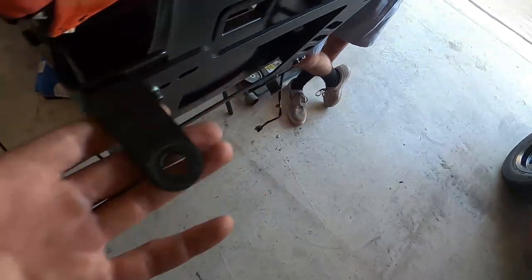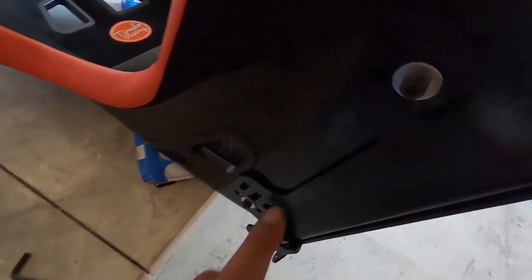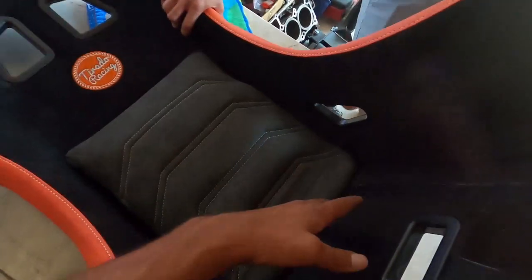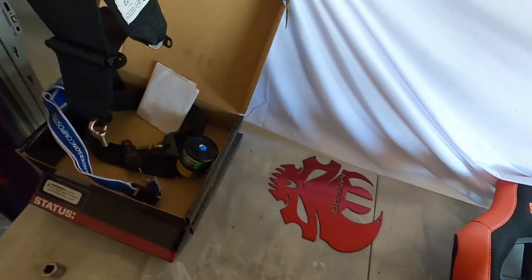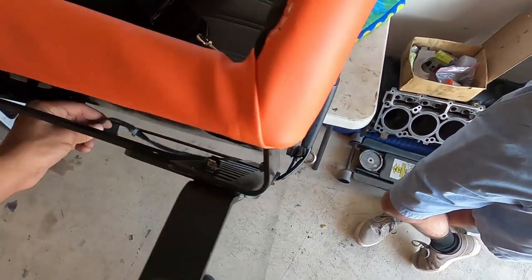The seat brackets are mounted and the seat will just walk right into place. I set this one a bit lower than the driver's side - about midway - so it's not so low that the passenger can't see over the dash, but not so high that they hit their head on the roof. I still need to attach the side harness eye bolt and tuck the seat belt underneath for when we're not using the harnesses. In the middle of filming yesterday the GoPro died and it was getting late anyway, so we finished the seat install off-camera. If you want an in-depth how-to, I'll link my original aftermarket seat install video in the description.